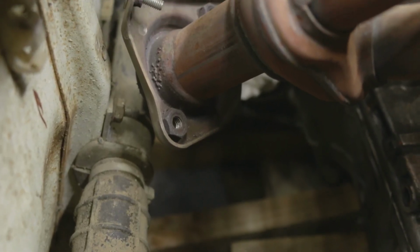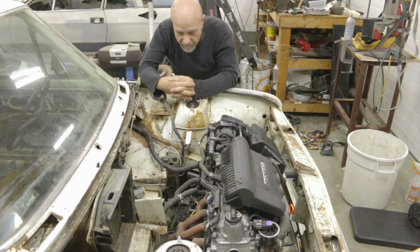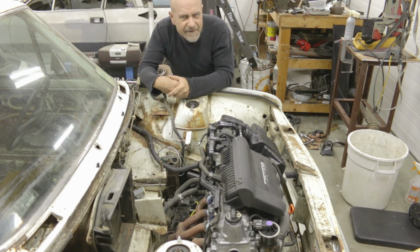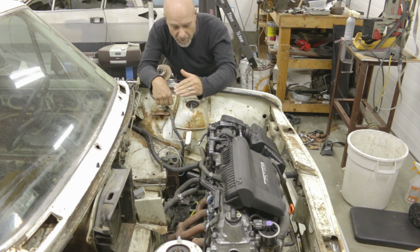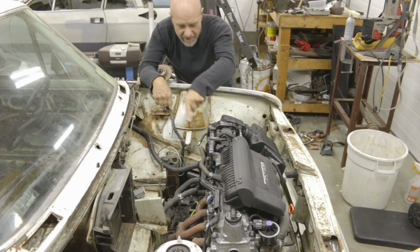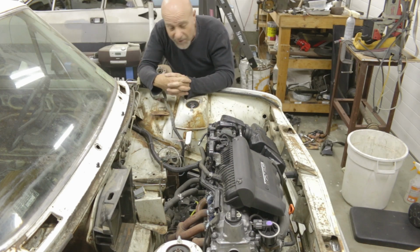It almost kind of runs directly into the steering rack, and that's fine. We are going to probably have to tweak the exhaust manifold by mounting it on some really heavy steel and heating it up to red hot, so it's nice and sort of pliable, and kind of tweak it up higher. And you're like, well, what sense does that make? Well, in the Honda Fit, the exhaust kind of exits from the manifold over the top of the steering rack. It's, I guess, their solution to prevent the exhaust from running down in between the steering rack and the drive shafts coming out of the transmission. And apparently it works in the Honda Fit, and so why don't I just take that brilliant idea and go with that.